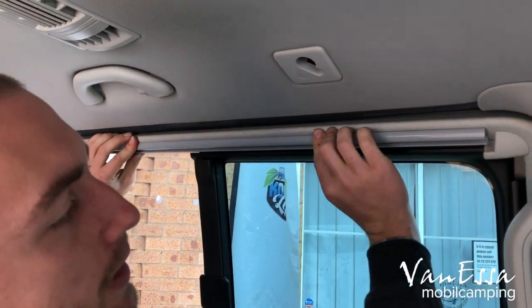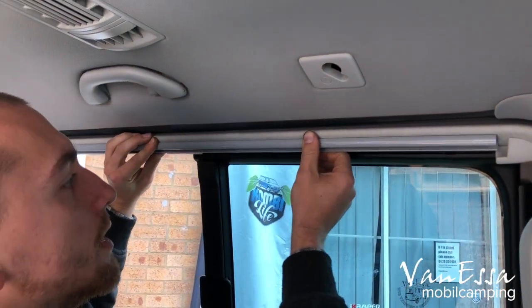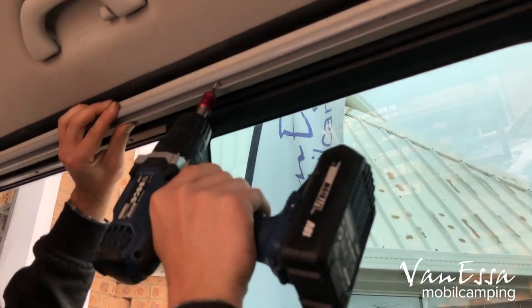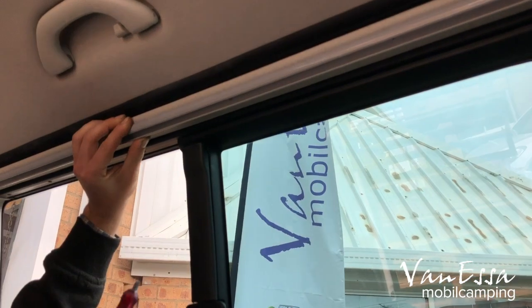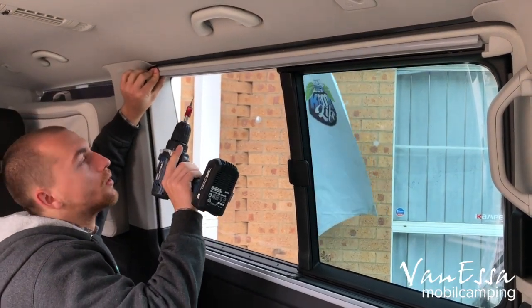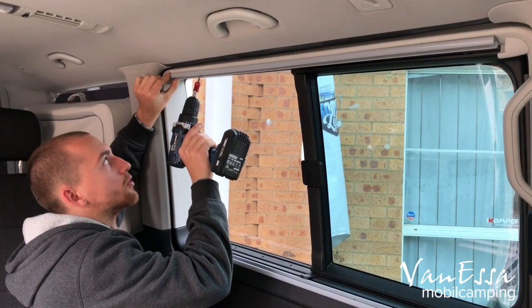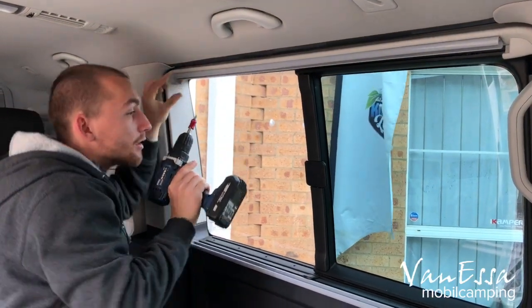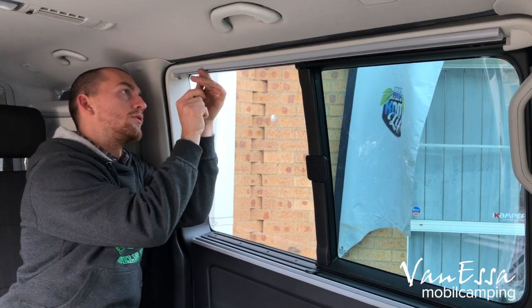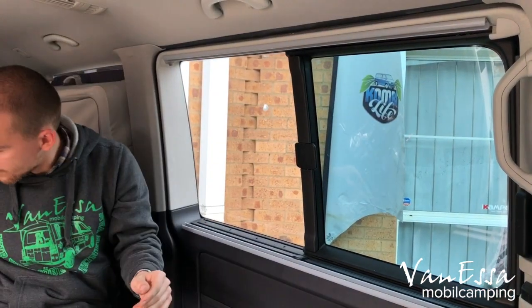Make sure you have the same amount of distance on both sides, which is about 10 millimetres. When you put the four screws in with the power drill, finish the installation by hand so you don't strip the plastic with the screw. That's why I advise hand-tightening the screws.